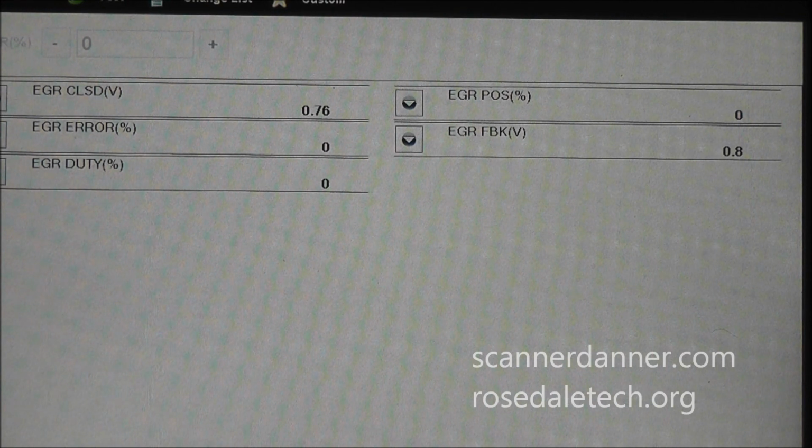So here's what I think. I think the car has been fixed for a long time, all these valves that he's been putting in here, but we never disconnected the battery to reset the learned number that's in there of 0.45. Now, some of you might be thinking, well, where'd the 0.45 come from? Because with 4 different valves, the lowest value we're seeing is 0.7, I think was the lowest we saw, 0.68 on one of them. I can't answer where that 0.45 came from, but here's a lesson on this, and I've seen this with throttle position sensors too, where the computer wants to see a certain voltage, and it's a non-adjustable TPS, and you have to disconnect the battery to reset that learned minimum TPS. It's the same thing with this car.